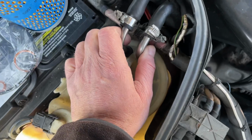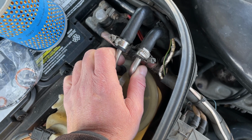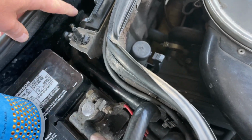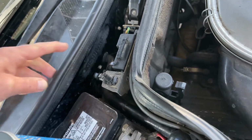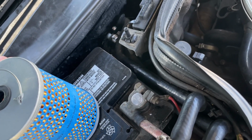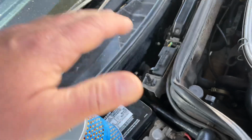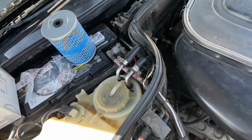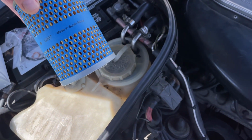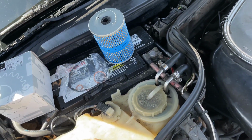They're both about a quarter open in warm temperatures, so there's always some coolant going through, but the full coolant cycle does not start until the auxiliary pump actually comes on via the ACC unit. Yeah, that is the preventive maintenance on it. I spent probably on this whole repair here in the front about $200 or so. These filters I got from Mercedes-Benz, they're now $8 or $9. You can see it's made in South Africa. Interesting. And that will get us going.